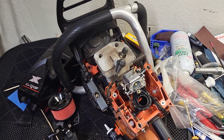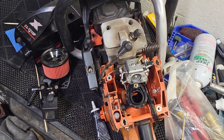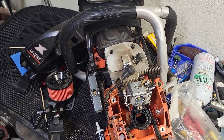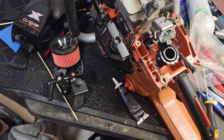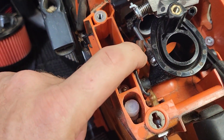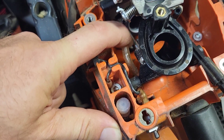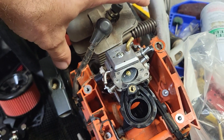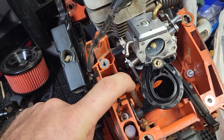When I did my testing, I just let it sit in my yard idling with this carburetor. It'd sit there and run for a little while, and it sounded just like when you run a tank plumb out of fuel — it zipped up and quit. Now, a vacuum leak can cause it to do that, but what was strange in this case was the fuel line was totally void of fuel. The tank had fuel in it, but the fuel line was totally void of fuel.